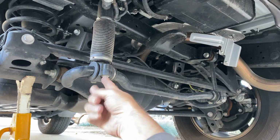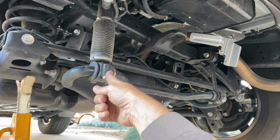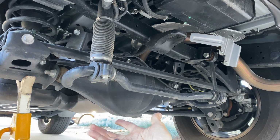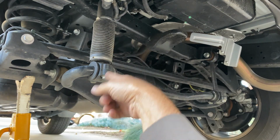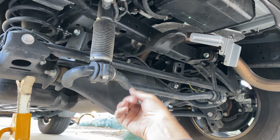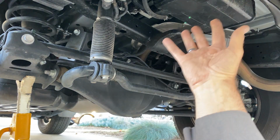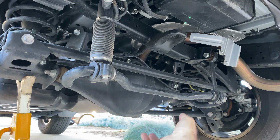So when you're cornering and this is held firm, then this point is fixed in space and the stabilizer bar can function and develop roll stiffness. When you're off-road in a mogul situation and this is allowed to move freely, well then this does not generate any roll stiffness. It just kind of wobbles in place back here and doesn't behave like it's there.